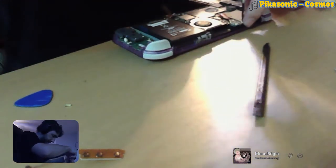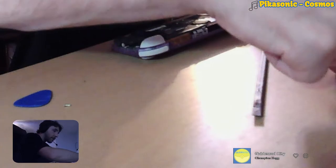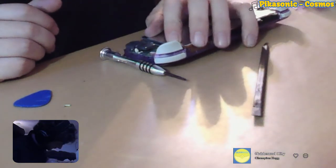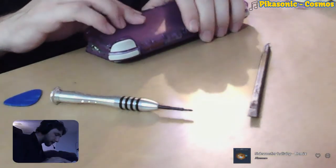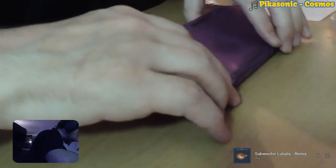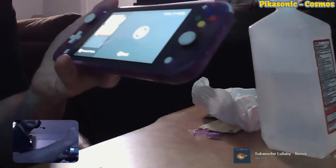Here I am putting on the game card slot, screwing in the heat sink with some new thermal paste that I got from EVGA, and then reapplying the heat shield in the back with, of course, more thermal paste. This next part I had to take some time off camera to align the buttons for the top on the Switch Light back plate here. As you can see, I don't have the nipple to get it put together properly, simply because I was having some issues — it was powering on and off constantly. I'm assuming the power button was just getting pressed. So I removed it just to test it, slapped it all together, and powered it up. And this is what I was left with.